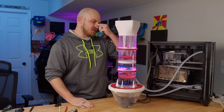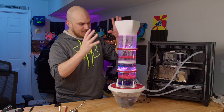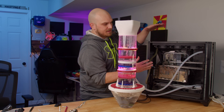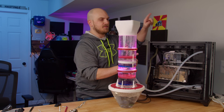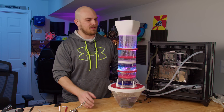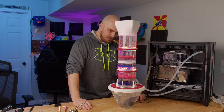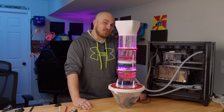The only way to know is to hook it up to the PC. I had to drain the whole thing and connect the tower to the system. The water comes out of the base, into the pump sitting behind the system, out of the pump into the distro plate. I simply disconnected the radiator and used the same loop path into the GPU and then the CPU. Instead of going back to the radiators, it now comes back into the tower. You'll notice a massive reduction in flow given how dirty my system is, but maybe that'll improve airflow. At least it sounds peaceful.